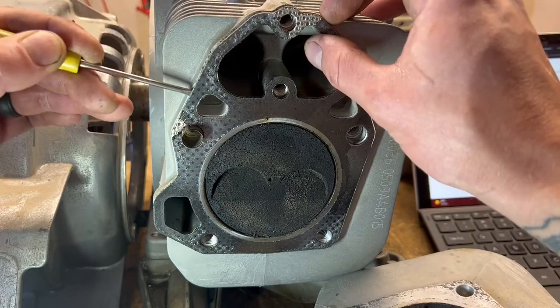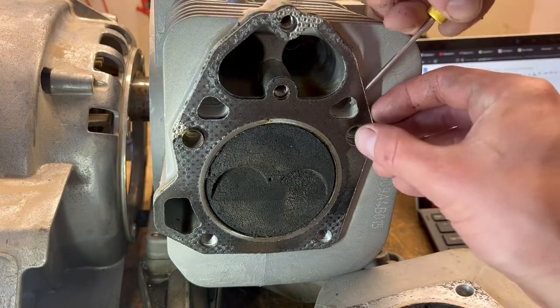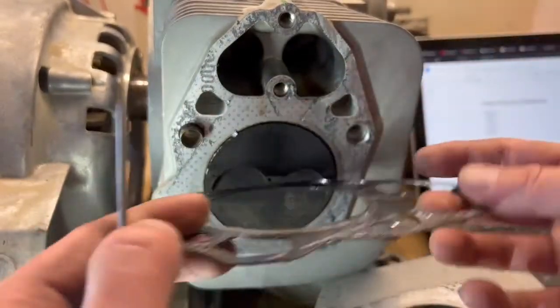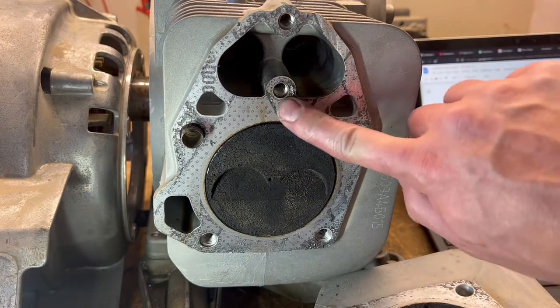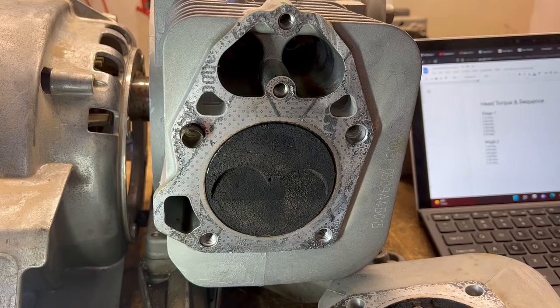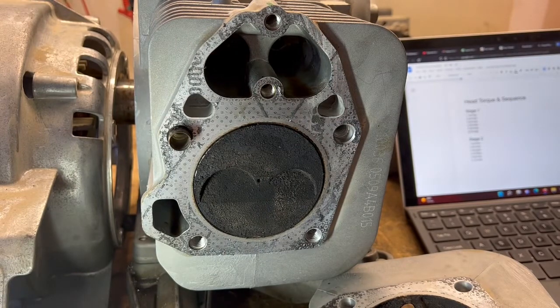Let's see if we can get away with reusing it — just nice and gently, because I've done this before and gotten away with it. We could reuse that — I would feel fine reusing that. It's not a big deal, especially since it's not a big deal to get the head off. For install, we would want to clean off this surface as best we could — you want it clean enough to eat off of. No oils or anything. I would use brake clean and a razor scraper with a fresh blade on it to clean it all up. But I'm pulling this head for parts, so I'm not doing reassembly — it's here to give you the information you need so that you can reassemble this yourself.